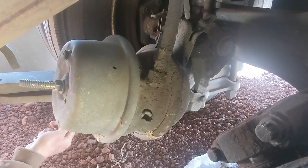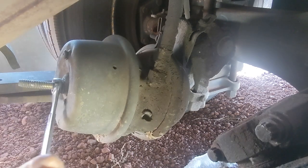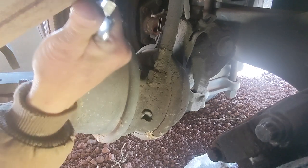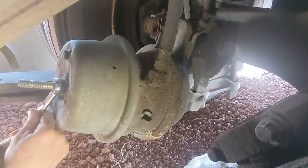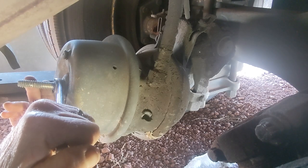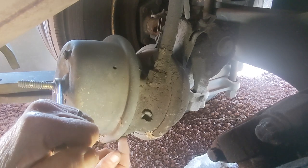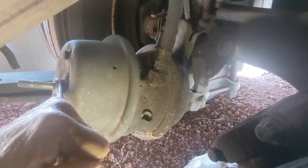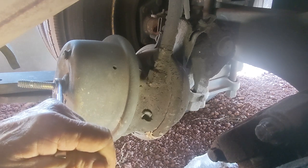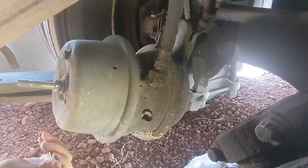Quick video — I just wanted to show you how to do this. I'll do this on the other side and then I can roll this around on my property. If you have to get it towed and you have a manual transmission, make sure your bus is in neutral. If you have an automatic transmission, the tow company will either disconnect the drive shaft or pull the axles out of the side of your hubs and out of the differential. That way your transmission is not spinning and potentially getting overheated while being towed down the road. That's a separate step — I just wanted to show you the brake caging. Be safe, thanks for watching.